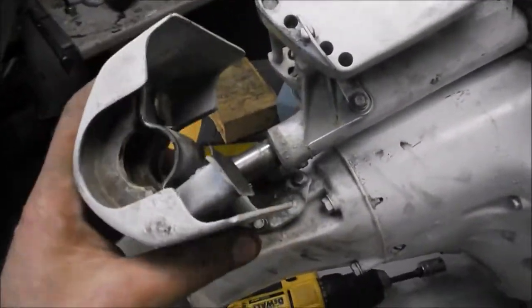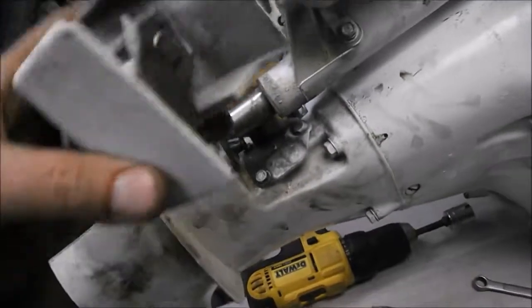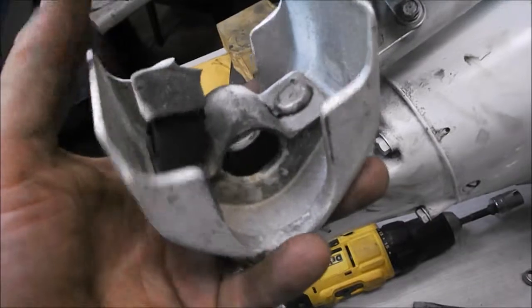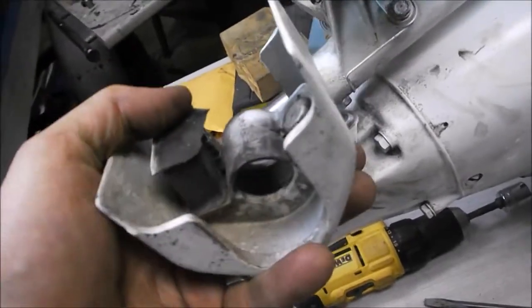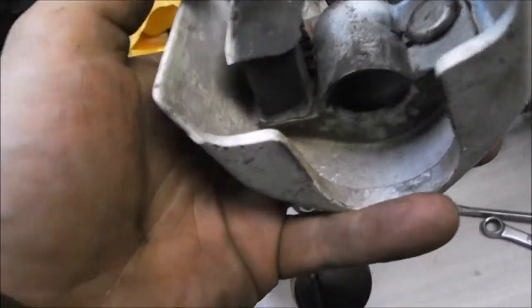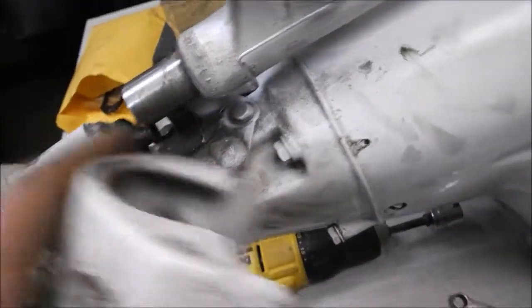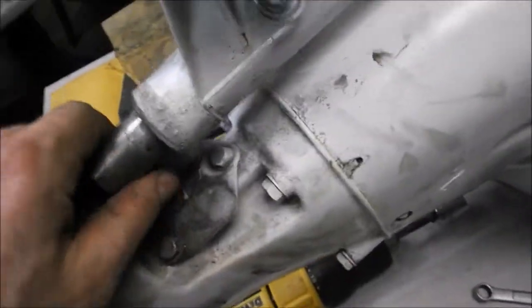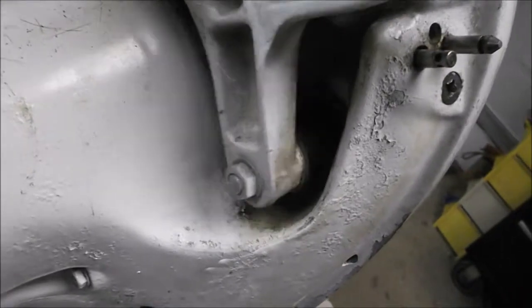Is your outboard waggling and banging around when you're riding it? Chances are you've got bad motor mounts. These rubber mounts are a common problem for older Honda outboards. This is what they look like when they're fractured — this surface right here is supposed to be laminated to this surface, and when that's bad it allows this to move around. That bracket at the bottom of the tiller handle — that's not supposed to come out. That rubber is supposed to be mounted...